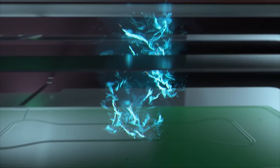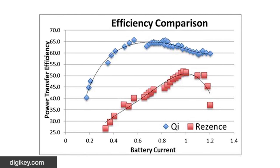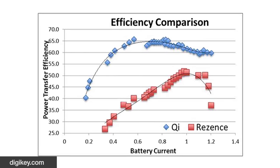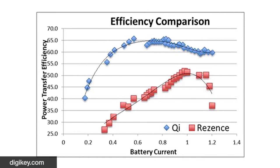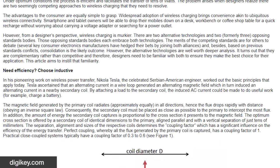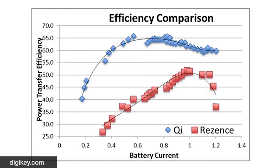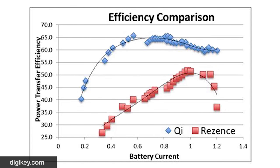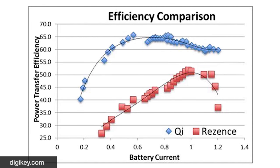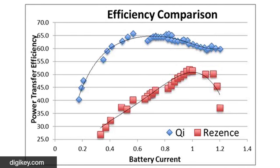Logitech has built this so it's not a meaningful negative charging effect unless you're at the very edge. DigiKey has a great chart of Qi chargers and resonance efficiency — I'll link that. Resonant charging's downside is it's a lot less efficient due to flux leakage — roughly 30% efficiency at two centimeters in an optimal system. This mouse is going to be much closer than two centimeters, but charging basically becomes useless once you lift off, though in normal use you're not lifting off more than it's losing.